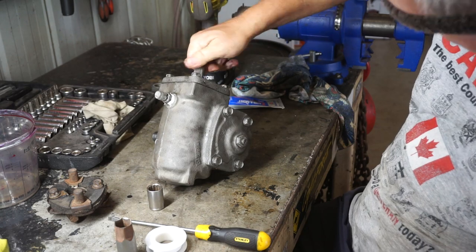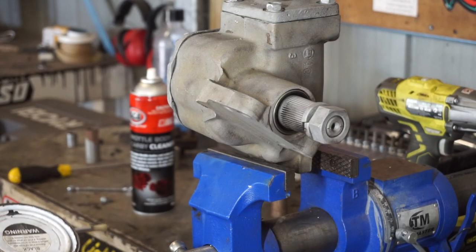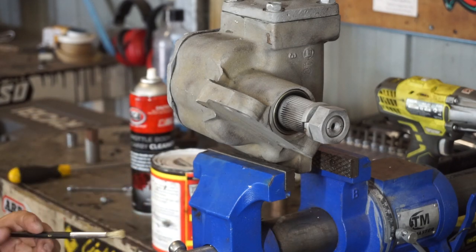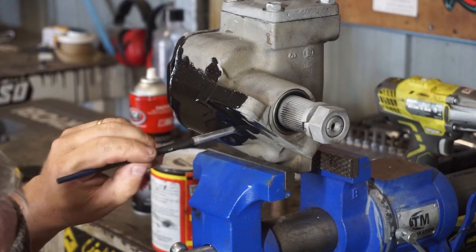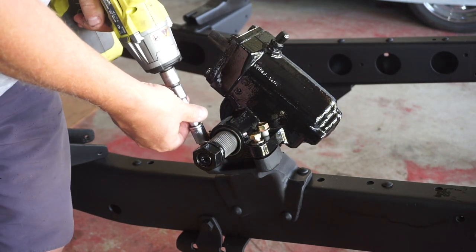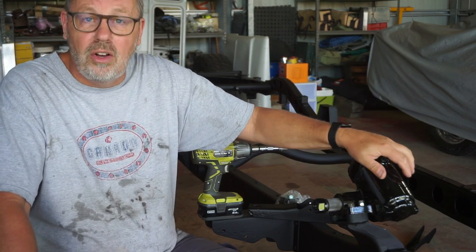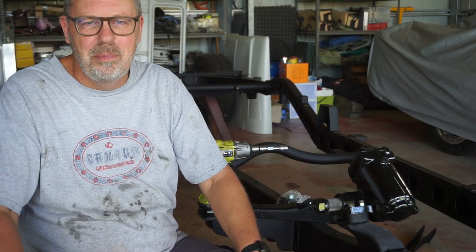One steering box rebuilt! I'll hit that with a little bit more degreaser and then paint it. I'm going to give this a coating or two of POR-15. I don't know whether you saw my video on the steering idler box where I also used POR-15, but if you haven't go check it out - I do talk about this stuff a little bit. I rate it very very highly. Don't get this stuff on your hands because the only thing that will take it off is time. POR-15 is all dry. Steering box mounted onto its mounting spot, just got to run the bolts down. Steering box rebuilt and remounted, ready for the steering arms to go back on. I hope you found something useful in this video - it was the first time I'd pulled apart a manual steering box, so that was pretty cool to have a look inside. Thanks for following along everybody, I appreciate you taking the time. Keep the shiny side up - see you on the next build video!